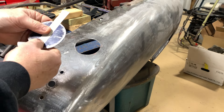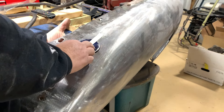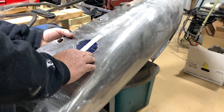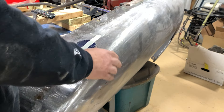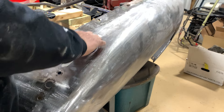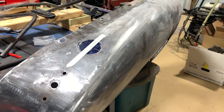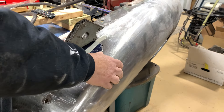I've also taken the part that we're going to weld in to cover up the gas tank hole and put a piece of tape on it. We've got it in place — this is like a third and fourth hand. You can manipulate the part, get it back where you want it, and make sure it fits the hole really well. I'm going to go ahead and put a piece on the back side too, just to help it so the weight of it won't sag down. You can also use one of your magnets to help out.